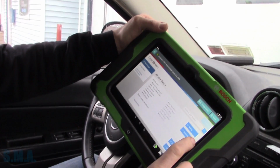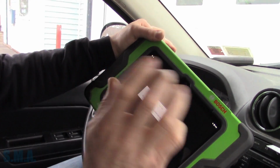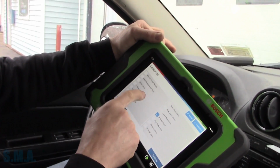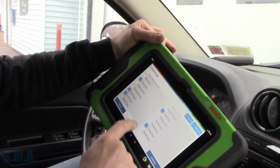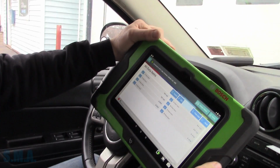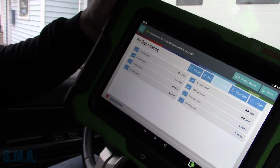We're gonna select some data here. What happens to these cars in the rear is it's a super chintzy setup, if you can believe that or not. Really crappy design. Left front wheel speed, right front, right rear. Wow, we got lots of wheel speeds here. And the little magnet falls off them is what happens. For some reason we have multiple data streams for wheel speed sensing.